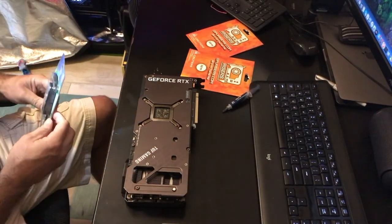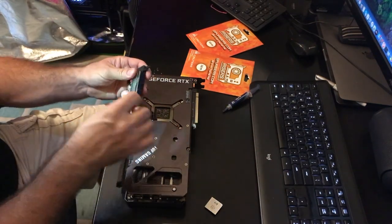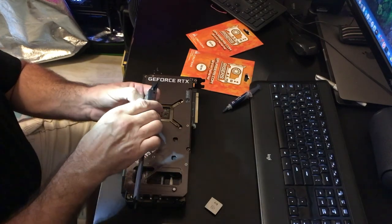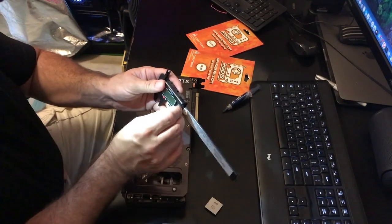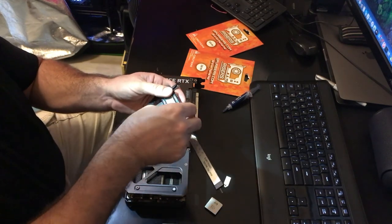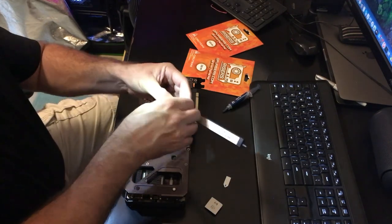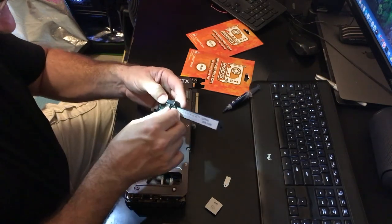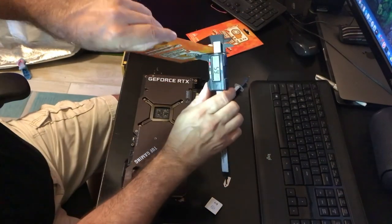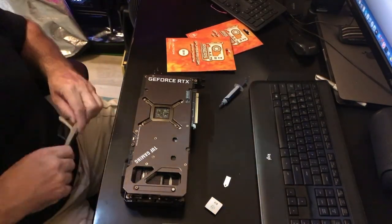I bought calipers just to make sure I'm using the right thickness on the thermal pads - mostly 2mm and 3mm. The 3080 Ti's were nasty, lots of thermal pads, and used up all my 2mm from my old Amazon pack. This caliper is only a couple bucks and it's worth it. You can eyeball it too when you strip off the old pads, but sometimes they get compressed and don't retain original shape. The thermal paste on the actual GPU chip is what's most important - when I took the 3080 Ti apart there was not much thermal paste and it was cooking hot.